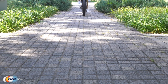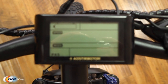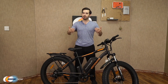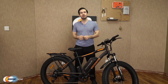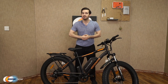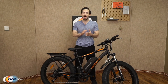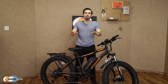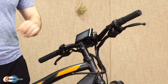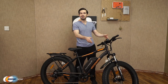That's pretty much everything I can impart about this bicycle without you riding it yourself. It's definitely a great long-term investment. Riding an e-bike can save a lot on transportation costs, it's good for the environment, great for your body and your mental health. Pro tip when assembling: first attach the handlebars, flip the bike over, and install the tire — that'll make the process very easy. Also loosen the bolts near the discs at the tires before attaching them.